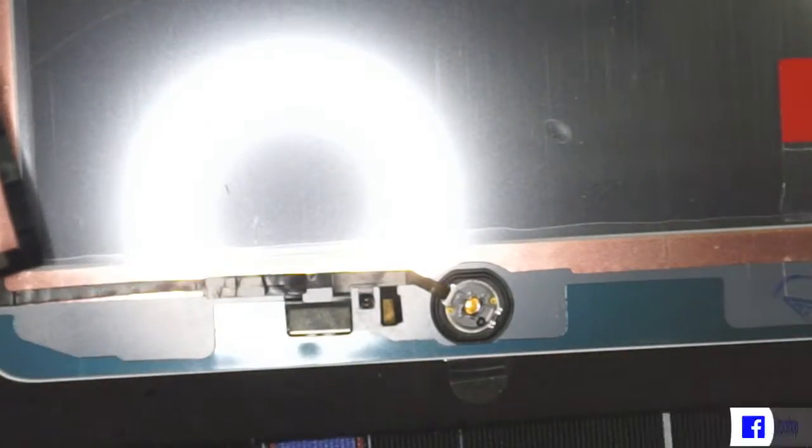I think with the removal of the excess adhesive, that's going to do the trick for us on this repair, and will make all the difference in not letting there be a floating home button that you can kind of push in a little and then slide out of place. Any more little bits of adhesive stuck to me? Not seeing it.